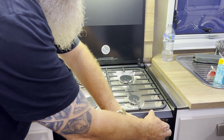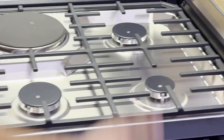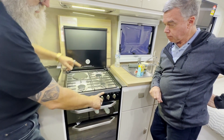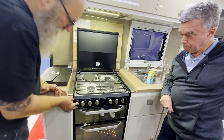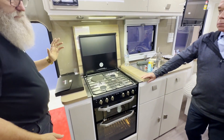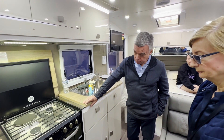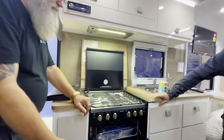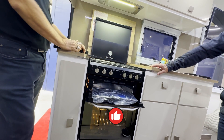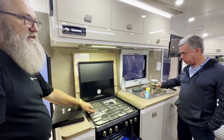You've got your two gas burners, your oven, your grill — gas and electric. The oven has a light so you can see what's happening inside. The grill door needs to be open when in use. There's a rack in the tray and heat transfer can go from the top unit down into the bottom unit, so please remove any plastic before operating the appliance — someone didn't, they caught fire and nearly burnt the whole van down. That's why the warning gets made.